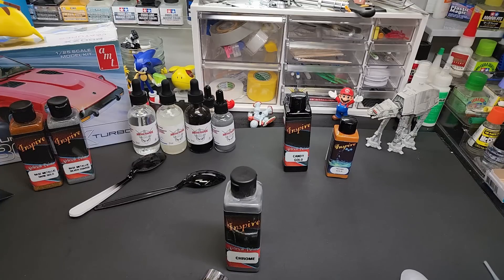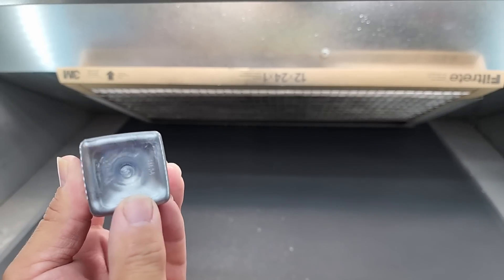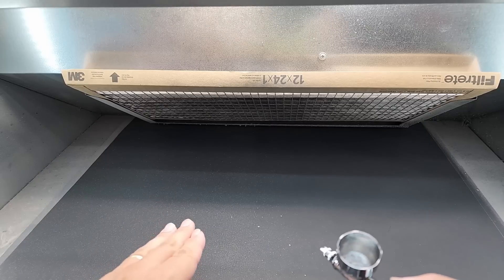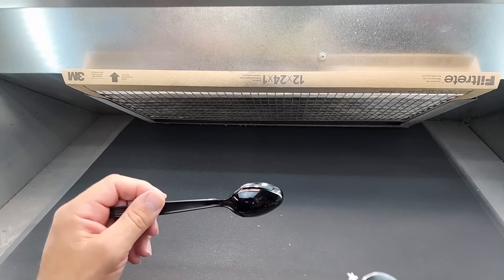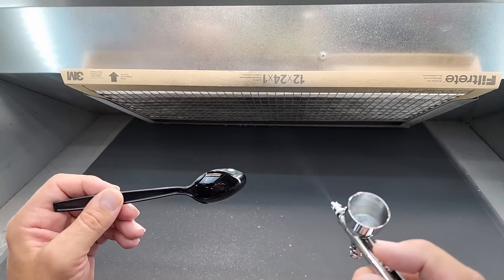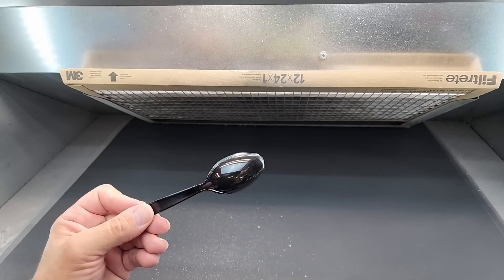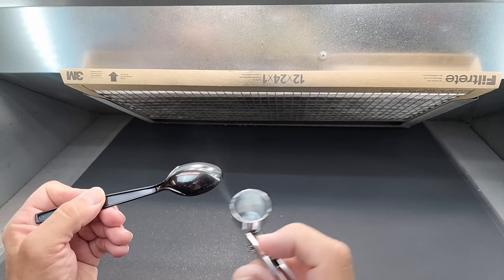Here we are at the Pace spray booth. I shook it up — make sure you shake it; you can see it twinkling at the bottom, no sediment. We're loaded up at 20 to 22 PSI. The company calls for a lot of air and very little paint, so I'm at 20 PSI and will pull back very slightly. It says you can buff it off between coats, wait a few minutes, and you can get into deeper details too. You can rub it off when completely done with a wet lint-free cloth for a nice dust-free finish. This is my 2K black I'm painting it over.